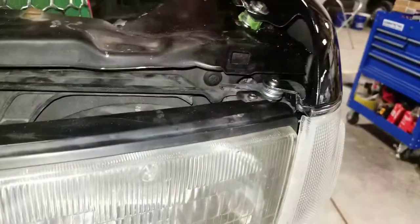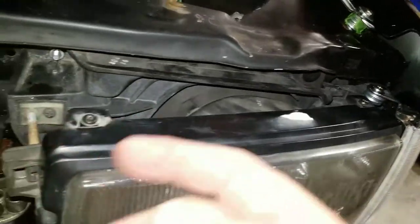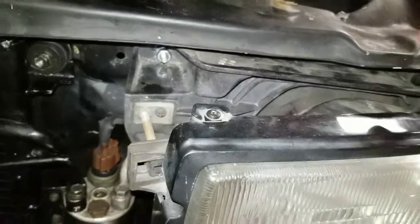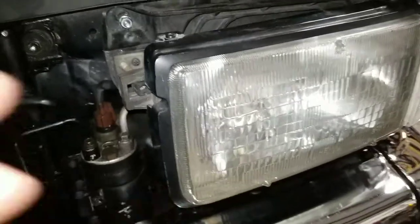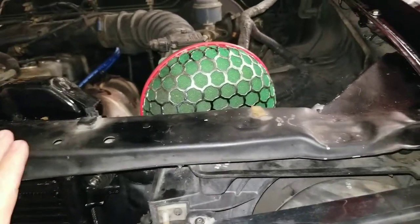On the other side it's got a hole but it doesn't work. What I suggest is coming over here, tying into your fender first on that side, then leveling it up, measuring a little bit, and coming off of your radiator support. Then you bore your holes accordingly — same way, you'll have to bore all four of them over here.